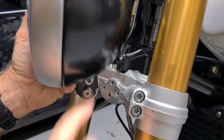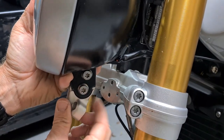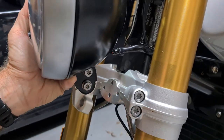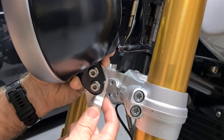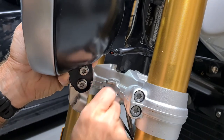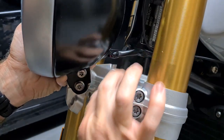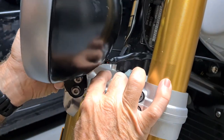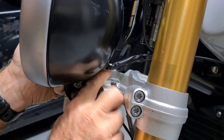All right, okay, I can see there's supposed to be two dowel pins there. I've got one dowel pin that's located in the original stay, nothing down below. I think old Herman, when he made the bike in Berlin, forgot to put one in there. So given the fact that I've got the top dowel still in the back partly, you can just see it, I'll use the pin that came with the adapter and we'll whack those in place. I'll get another pin, and we're just going to locate the adapter on top of these pins.